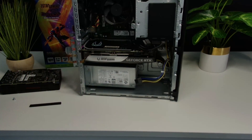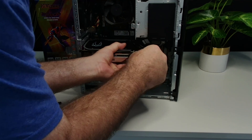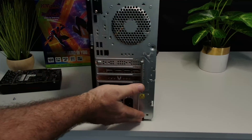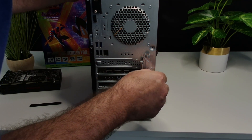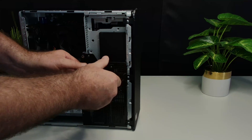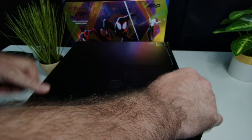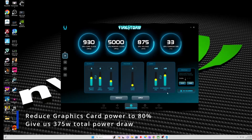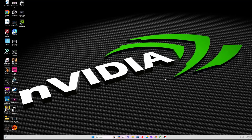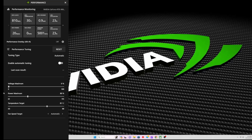While we work on this PC, let's talk about total power draw. When I did the math, I came up with a total power draw of 405W — but remember, we only have a 400W power supply. The old RX 5500 4GB drew 110W. I've also seen upgrades with the RX 6600 which draws 132W with no issues. The 4060 Ti draws 160W total, so to avoid pushing the power supply too hard, I'm going to reduce the power consumption of the 4060 Ti to 80%, which will bring it down to about 130W.